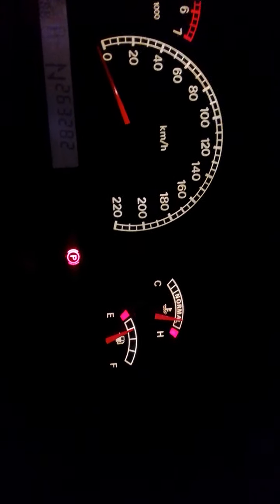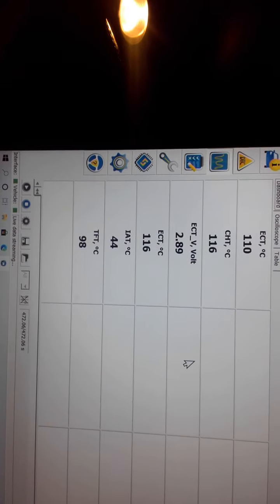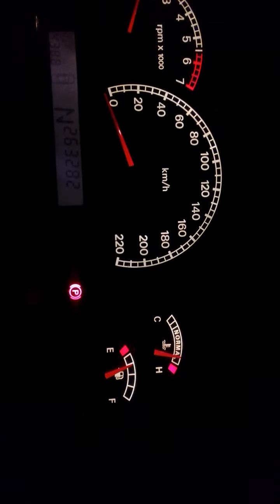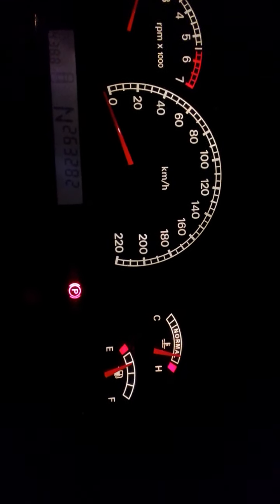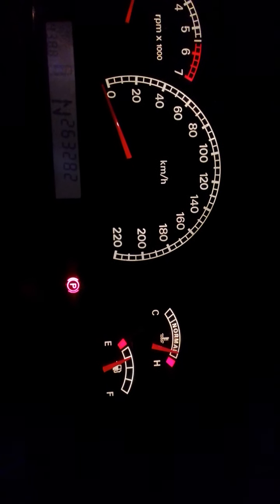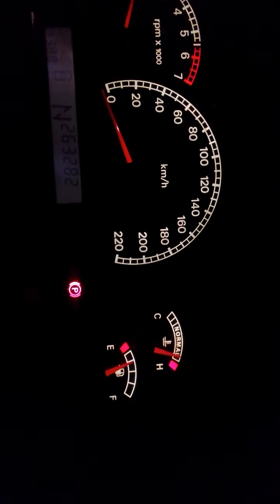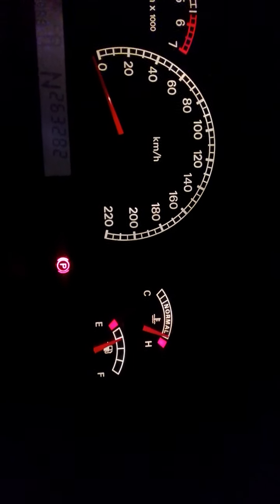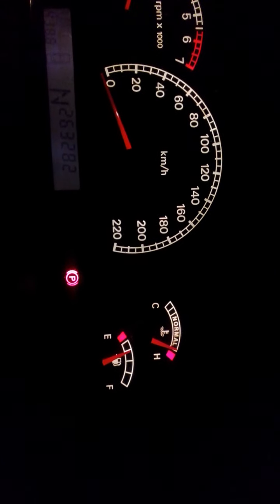It's coming up to the L — we're at 116 degrees, still no warning lights. This is why you shouldn't rely on your gauges — they're usually a bit too late. I'll pressure test this motor to 120 so we'll see if it holds up. We're at the L, 118 degrees, just nudging it. We're just about on the H — still no temperature warning light or chime.